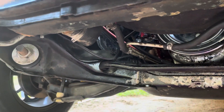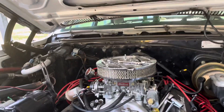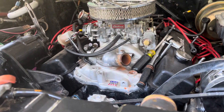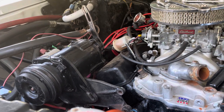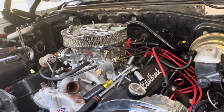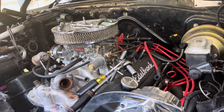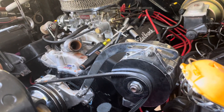I haven't tried to pull it down yet. All the bolts are loose. I had to loosen up my air conditioner to raise it up. Took my distributor cap off so I won't crack it. Took the fan off so it won't hit the radiator.